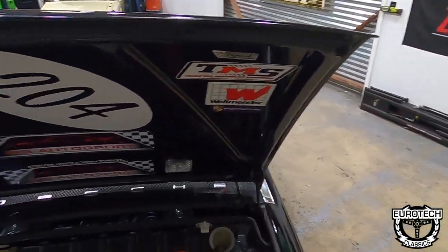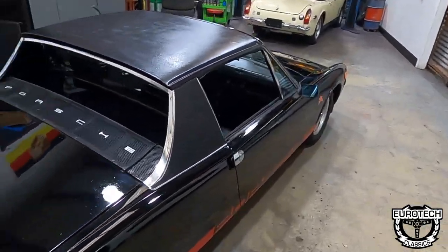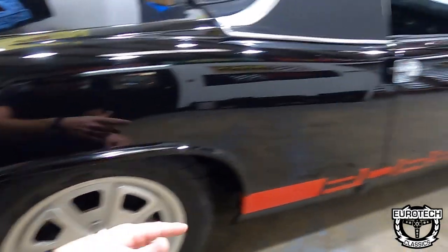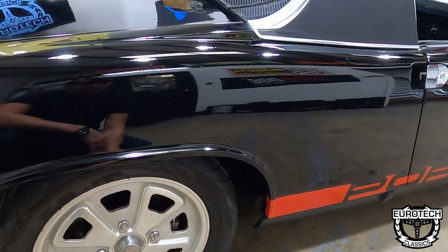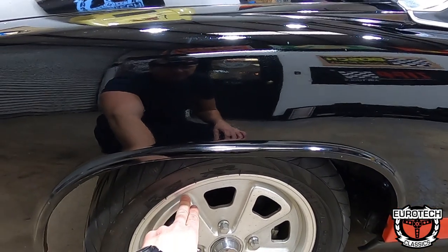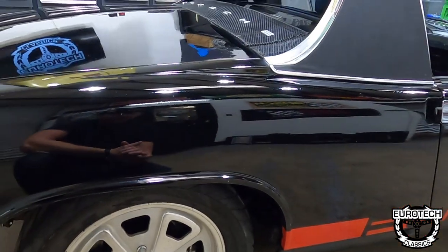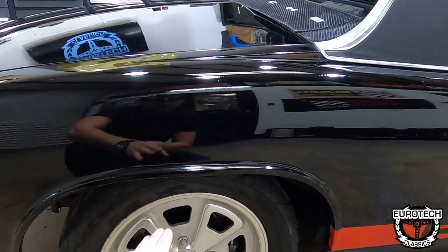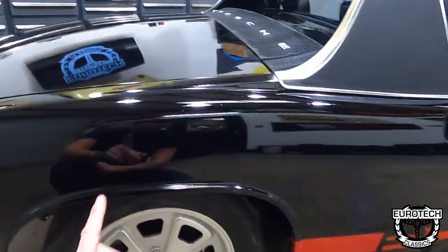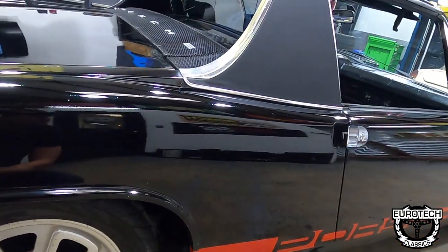This one has an MSD ignition system. I went with a track tire — what we'd call a plus-size tire, a 205/50/15 — so that gives you an idea of what it looks like. This car has been lowered as mentioned. These are those Fuchs wheels that are really cool and they're in original condition, not chromed or repolished. This is an easy way to tell if it's a four-cylinder or six-cylinder: this one has four lugs — four by 130 millimeters — versus normal Porsche fitment, which is five by 130 millimeters, indicating a six-cylinder.